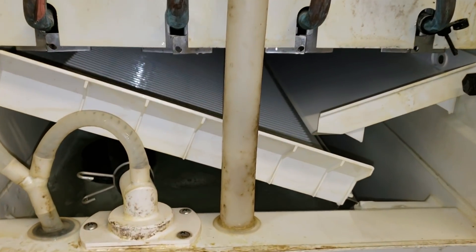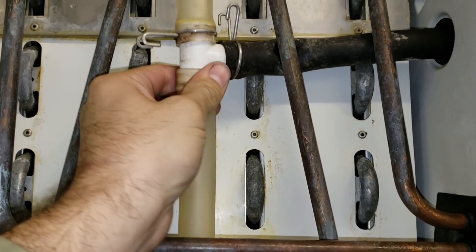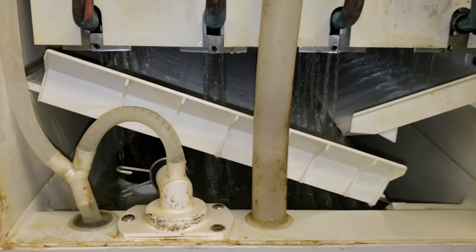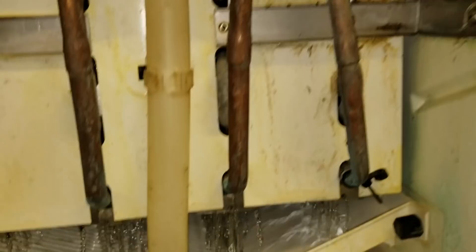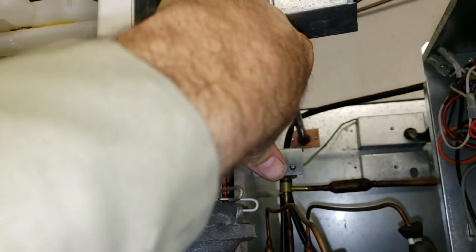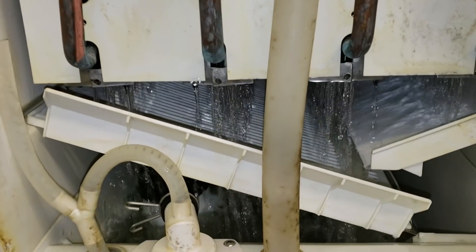Once I've drained all the water off, I filled it back up with hot water again. Be careful — I didn't put the clamp back on so you don't want it to pop off and blow you in the face, so you've got to be ready for that. I'm going to go ahead and turn the pump back on, circulate it, and then drain it again. We're just getting hot water running through the machine, rinsing out any cleaner. Open the cleaning valve back up. We'll do this one more time, then run a sanitizer through it, and then we're going to be ready to make ice.